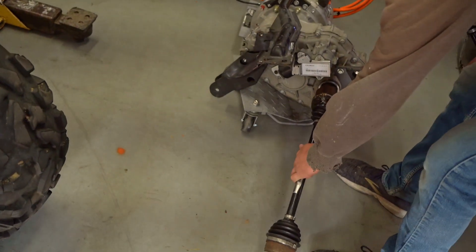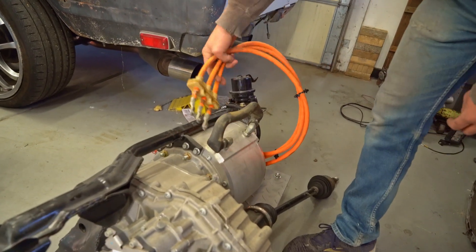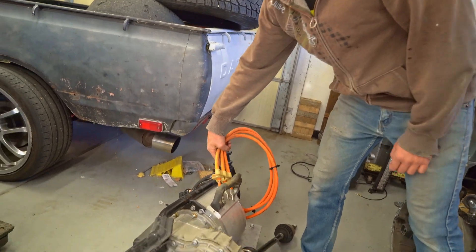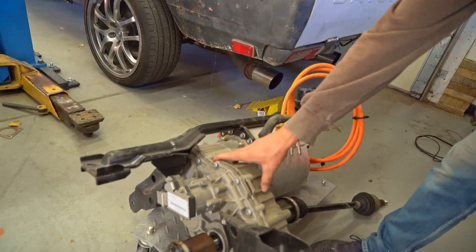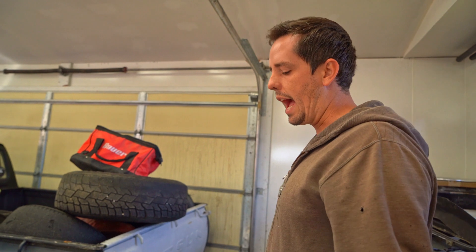This is the electric motor that came out of the Coda. The actual motor is just this section here — three wires connect into the motor controller. It bolts right up to this transmission, which has about a six-to-one drive ratio. There's no shifting — straight from motor to axles, a direct ratio, so it's super efficient and very smooth. As you hit the throttle or brake it's one continuous response rather than having to clutch or shift. The Codas had a top speed of around 120 miles an hour, so in a Razor that's going to be terrifying.